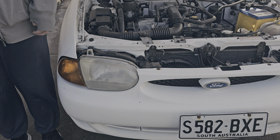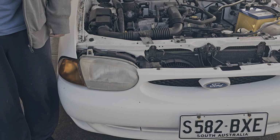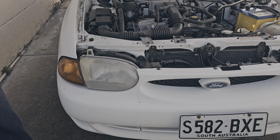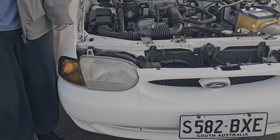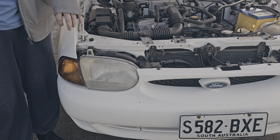This is a little bit different from the norm because this is me working on my car for once. This is a video on how to clean up your headlights completely, starting off with 800 grit sandpaper, then 1500, all the way up to 2000 to give your headlights a real polish.